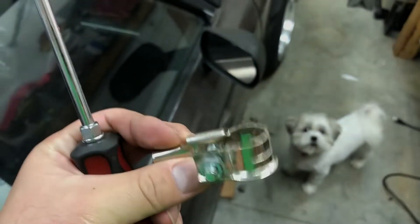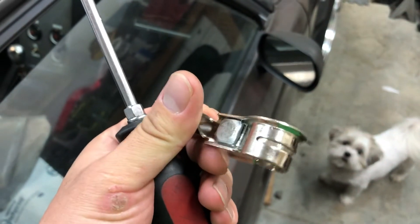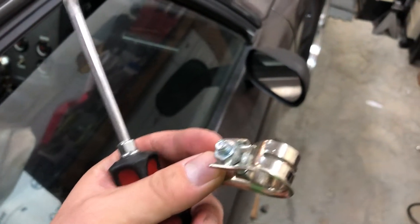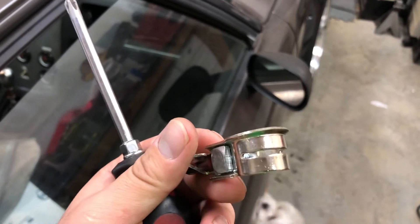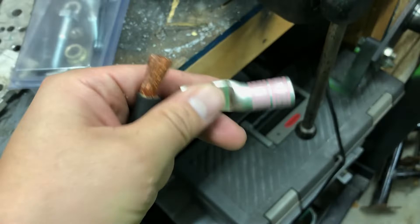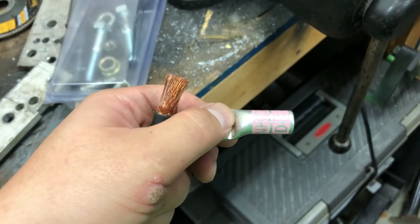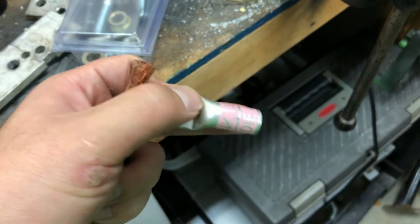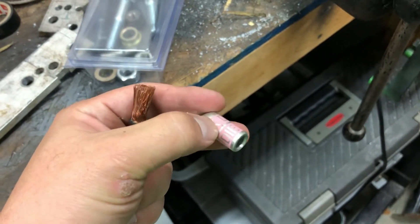All is not lost. What I'm going to do is take the cable out - this is just the ground cable that you take out - and use my vise to crimp a real terminal on. The terminal and the wire - I'll put them together and put them in the vise, and then find something to push down to make the crimp.